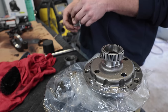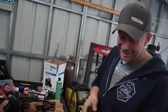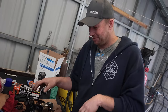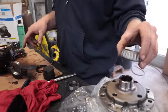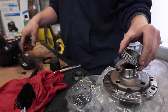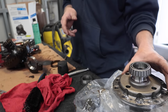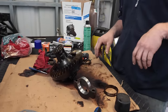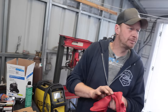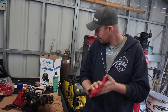So you can stick a 31. As in this part of the video, we believe that you can. It might change later, but we can put a small bearing race in the cap of a small bearing 28 spline with a bearing on a 31 spline TrueTrac, stick it back in the case and have it work. So that's good. Now we don't have to ship things back and forth and we can use this one.